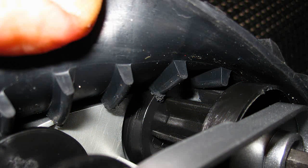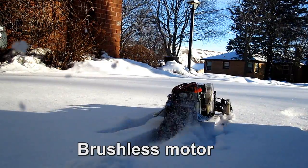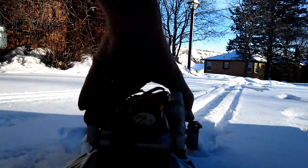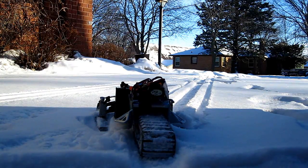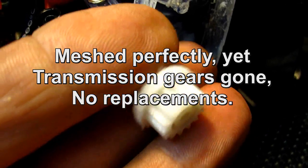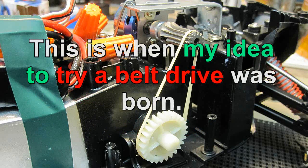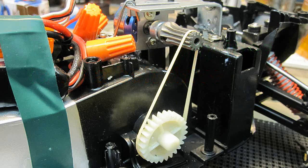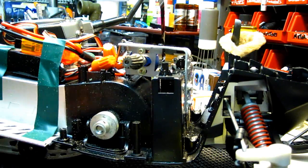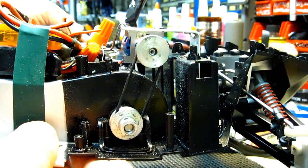Here's what happened with the first brushless motor run. I was going to work on the steering later, just wanted to see if it would go. Well, it was fun for a few minutes — just too powerful a motor. With the right belt it might just do it, but that low starting torque on the brushless motor proved it was unable to start with the tension of the right belt.